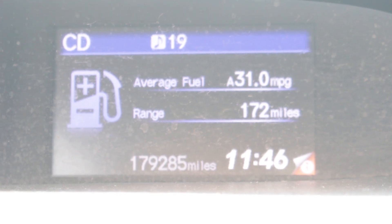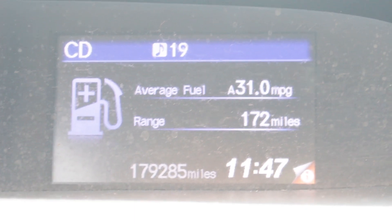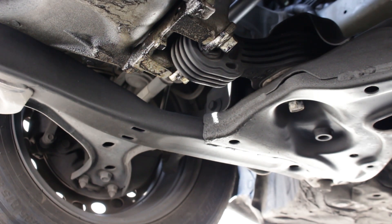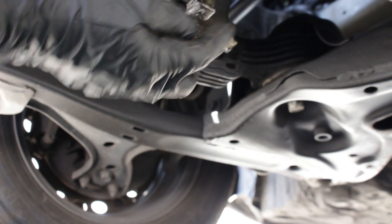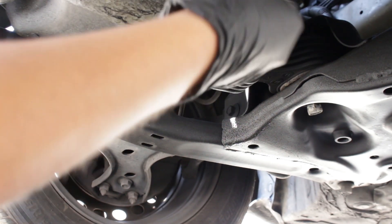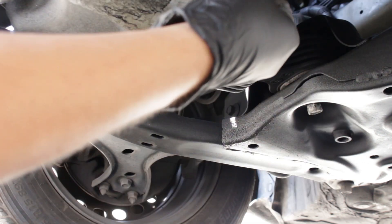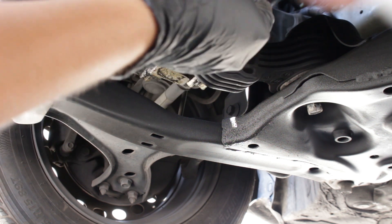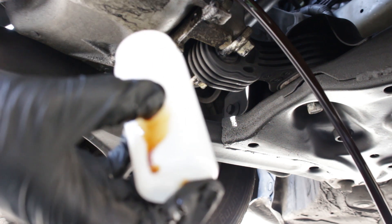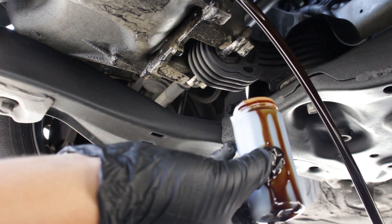It's been three months and we've hit the mileage — it went a tiny bit over as you can see. We definitely surpassed the 10,000-mile oil change interval. Showing the odometer here. The drain bolt is off and I'm collecting a sample for oil analysis — roughly 10,300 miles. Just let it go into the sample tube like that — done deal, sending it off.